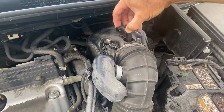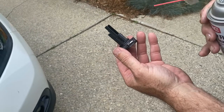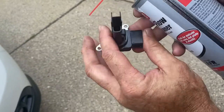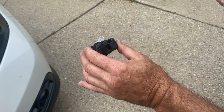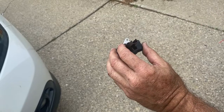Let's pull that right out just like that. As I mentioned, this light was on a week, off a week, and if you look at this, you can see these right here are pretty clean but you look inside and those are dirty — and the car does have 80,000 miles. These should be cleaned every 40 to 50,000 miles just to make sure the car is running properly. So we're going to clean these and reinstall it.